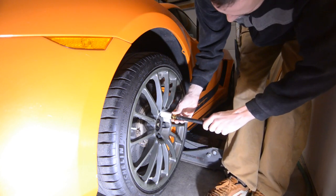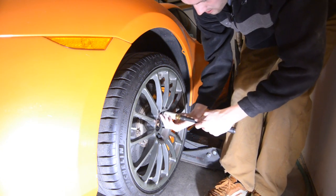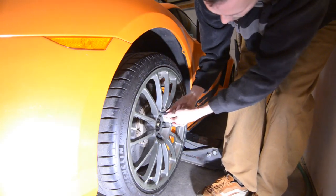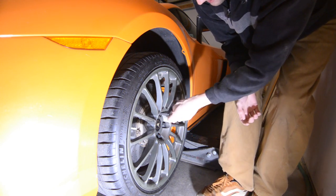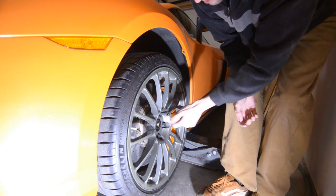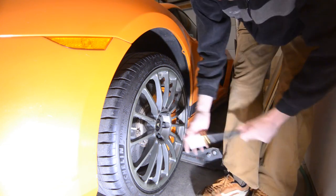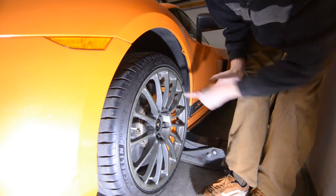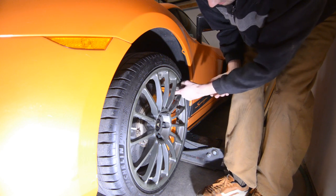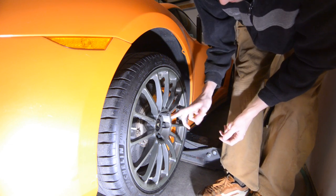Now that the car is jacked up, I'm going to take the top-most wheel bolt out. Since we loosened it on the ground, it's a lot easier. I take that one out and then insert one of these little guide pins that screws into the hub — I found this in a junkyard from an old Audi. I'll link a metal version in the description. What it does is guide the wheel as it comes off and prevent any damage to the caliper paint. So I'm going to loosen all these bolts and take the wheel right off.